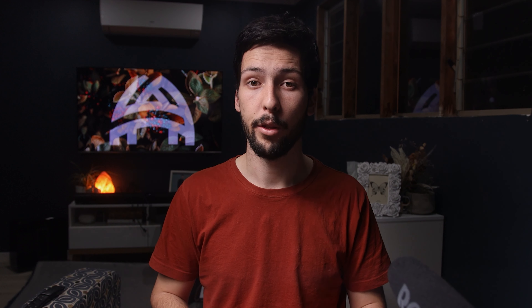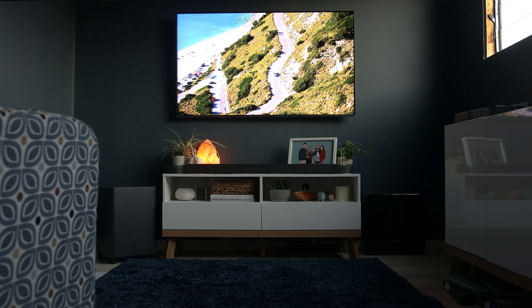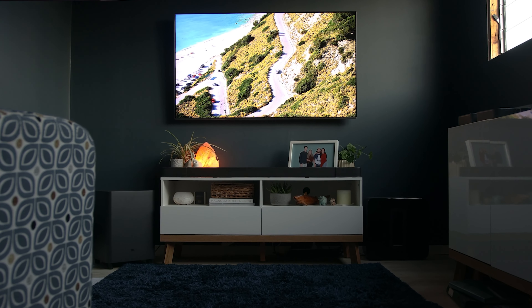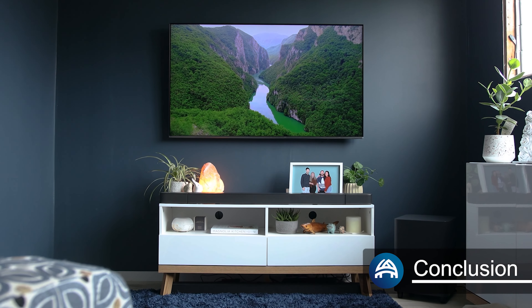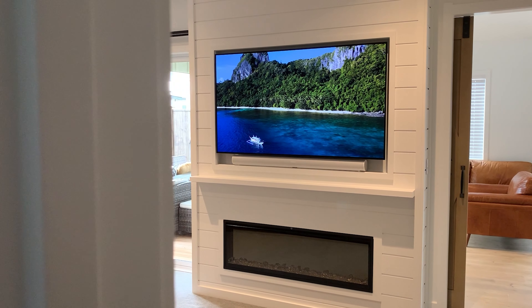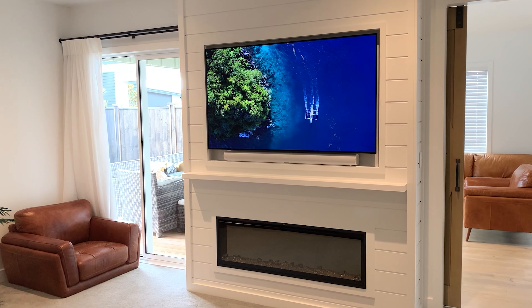The rear speakers are designed to give you full music playback, so you can use them as a kind of multi-room setup, so long as you're within range of the main bar. I used them outside on the patio and they worked really well. If you're going to do this, I'd suggest getting a couple of speaker stands so you can get them higher off the ground and move them around more easily. I'll leave a link below to my video on the best rear speaker stands for soundbars. Try to elevate the rear speakers above ear height to get a better 3D sound, and play around with positioning before committing to mounting them on the wall.